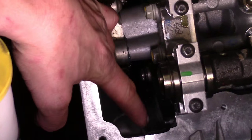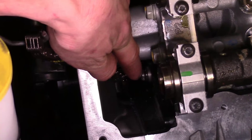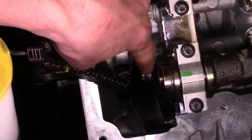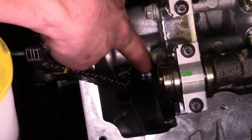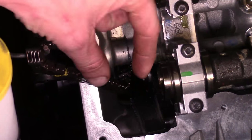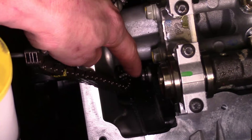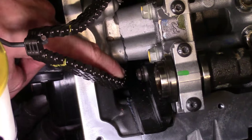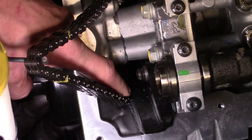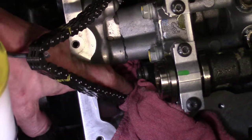Before I can take the cylinder head off, there's a timing chain guide right here with a T30 Torx, and I don't have a lot of room. I've got to get that T30 loosened and backed all the way out. It's long enough that it won't come all the way out — it will go until it touches the timing cover and will be fully unthreaded from the head. Works best if you get the shortest T30 you can find, put a wrench on it to break it loose. Before you bag out that T30, place a rag down in the passage so that if you drop it, it won't fall down inside the engine — which would completely defeat what we're trying to do here.